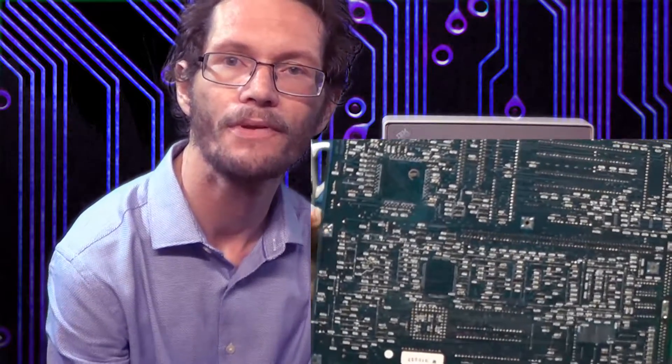Now, at the start of this video I mentioned I had to repair this machine — you may be curious what went wrong. It was put away in storage as a perfectly working system. I pulled it out and the first thing I got was a 2401 error, which from memory is the VGA subsystem. I was also getting very bad output on the VGA port, so I decided to switch the motherboard. That seems like overkill, but with all the SMD components underneath that you don't see until you remove the board, and not being able to visually see any faults, it would have taken a long time to diagnose. In a recent collection I acquired a spare Model 3286 motherboard, so I thought it was a perfect opportunity to test it.